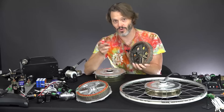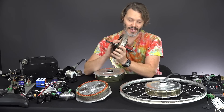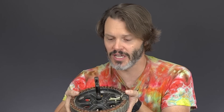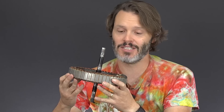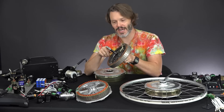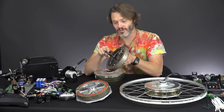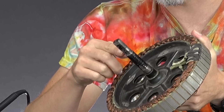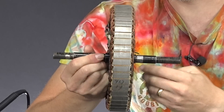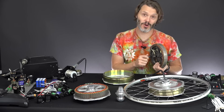There's really not a whole lot of space to have a torque arm here. They will tend to damage your frame or damage your torque arm over time, especially if you have regen — it'll go, then the regen will hit, and it just rocks the nuts loose and rocks damage into your torque arms. It is an extremely poor design that somehow is still on the market. I don't even know why manufacturers keep doing it other than it is cheap. The average Chinese manufacturer is extremely hesitant to ever change anything once they have the engineering already done. Have you ever stripped out the threads on your hub motor?